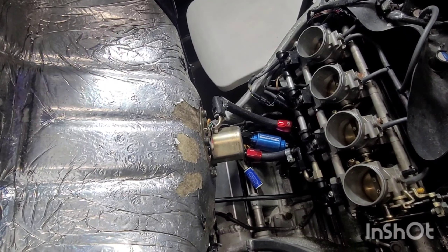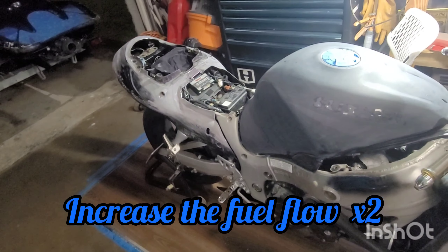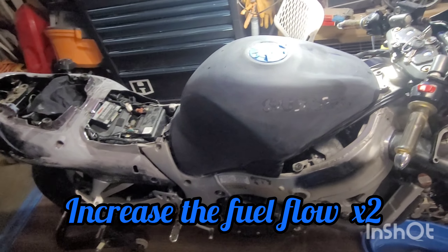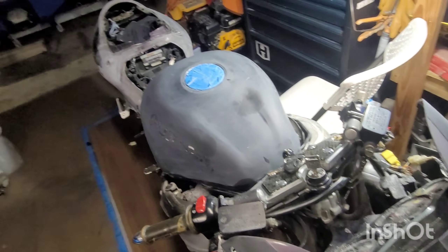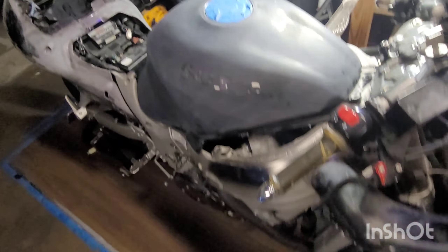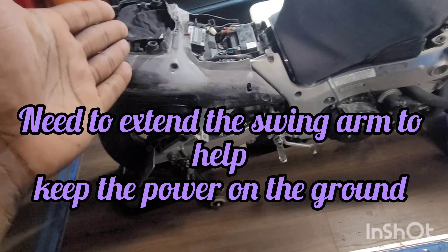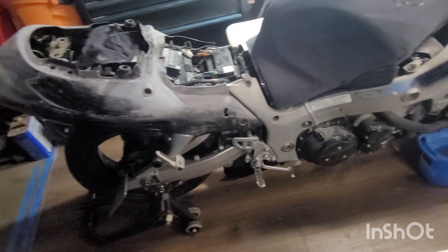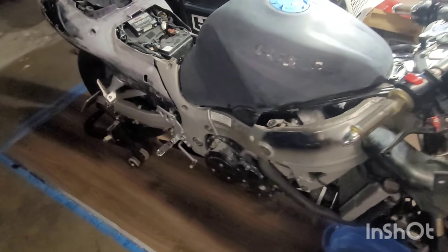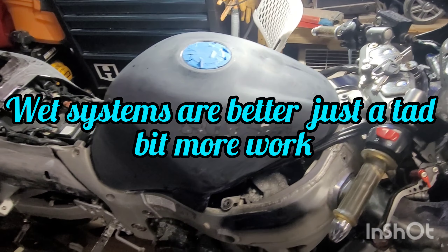I added an inline fuel filter, and then I pulled the pump and modded it to make it flow a whole lot better — like 200 percent. Then we're gonna add the nitrous. We got the air box in there where we're gonna add nitrous for each individual cylinder. We're going to extend the swing arm, put the nitrous setup in there, put a couple of solenoids. We might actually do a wet system — everybody does a dry system, but we're gonna do a wet system and get as much power as we possibly can. Hence another reason why we needed to mod the fuel system.